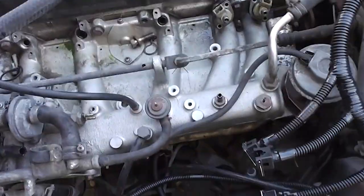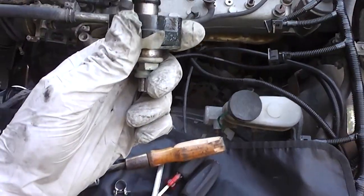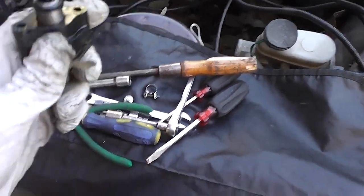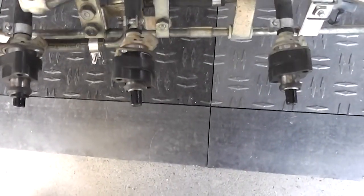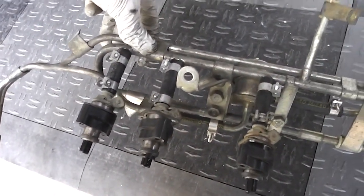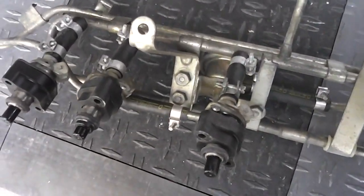The fuel rail is out. Here's what we're left with, minus a couple of injectors still inside the manifold. This is the factory fuel rail — as you can see, it's a huge trombone-looking thing. Due to the extensive design of these fuel rails, they were prone to a lot of heat soak, especially in hotter climates, which is why they had that injector cooling fan.